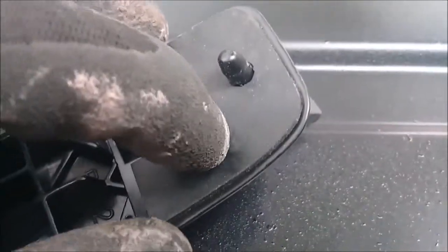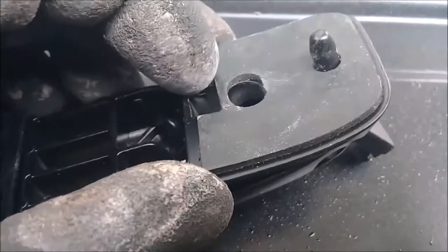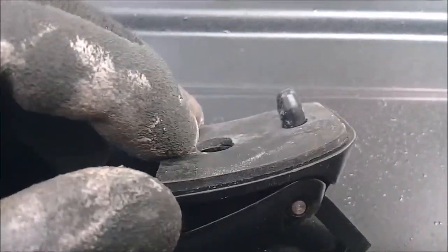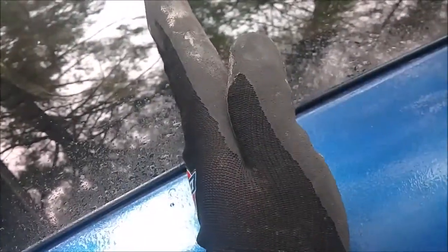On the truck side, there is also a thin rubber layer as well, so that presses it a little bit just to get a good seal on it. This plastic piece that extends is actually to fit right into here. The factory designed it to ensure that the hinge stays aligned — it will actually align itself as you put the hinge on.